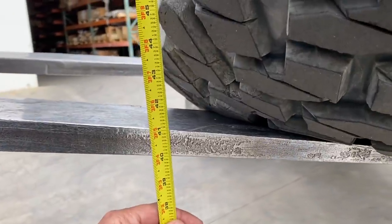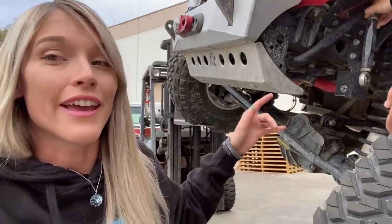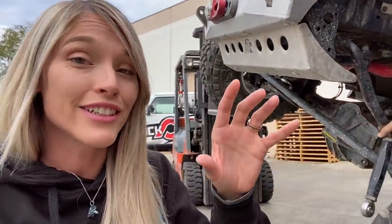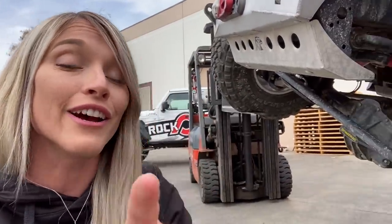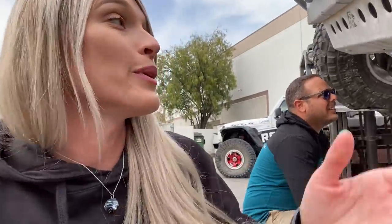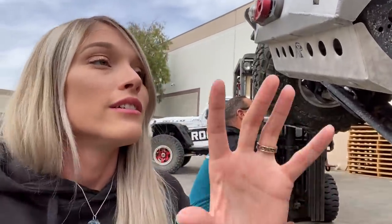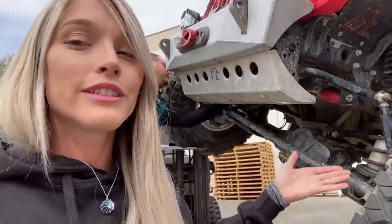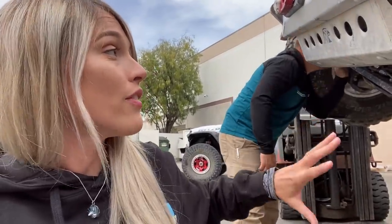On our setup, it's exactly the same. When we installed the Hemi and swapped to the longarm, we had to change our up travel. We had to bump-stop the rig because we were hitting things from the bottom of the engine — like the oil filter and the AC compressor. So that was our limiting factor. On a different setup with maybe a factory engine, you might see a difference, but with ours there isn't. What I'm very curious about is what the change is going to be once we install the anti-rock, which should be pretty cool.